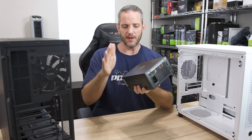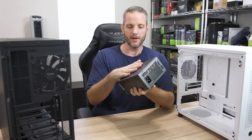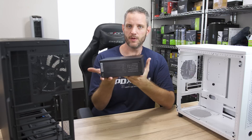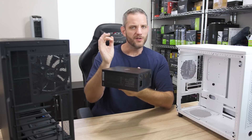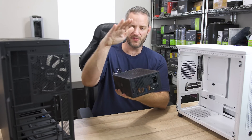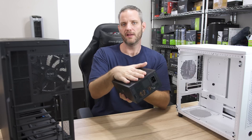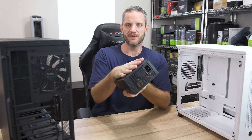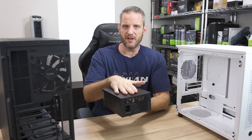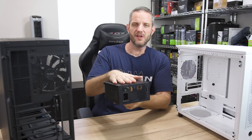Lastly, I'm talking strictly to the water coolers here. If you are water cooling your system, it's good peace of mind to mount the PSU fan-down if you can, because if you accumulate some sort of drip or a leak, you don't want it dripping inside your power supply while it's on — that could lead to a very bad day. If you mount it fan-down, it's just a little bit of extra peace of mind that water will drip onto a solid piece of metal and really has to work its way in rather than falling straight in.